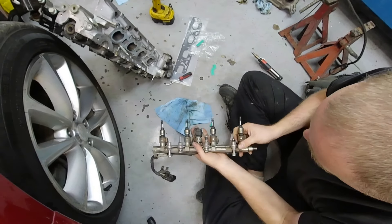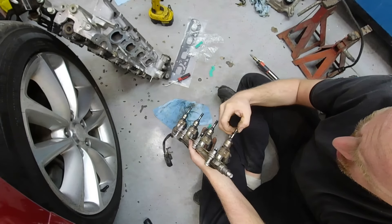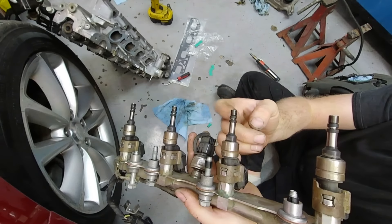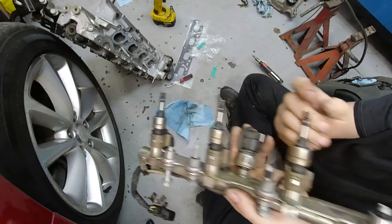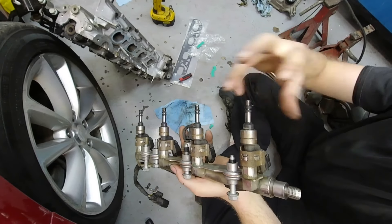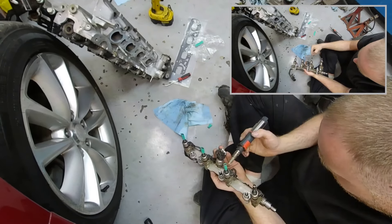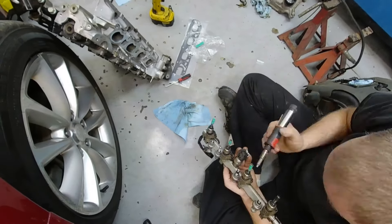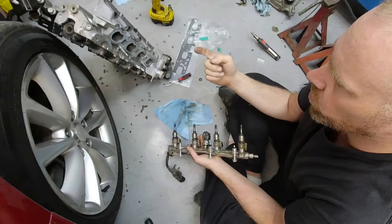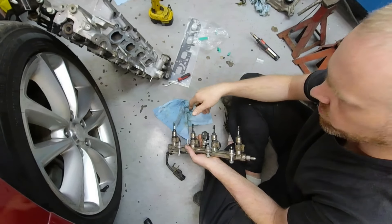It didn't go as planned — letting it sit a little bit did not allow it to shrink down on its own. In order to get it to seat, I had to use some heat shrink tubing. The ones I just put on are sloppy loose, but the ones treated earlier are actually tight. They must be set up to squish when you put them in the head to fit properly. I'm going to add just a small amount of oil to the surface of the cylinder head where these are going in, then slowly work them in and get to putting the cylinder head back on.